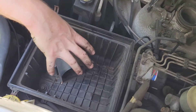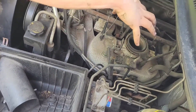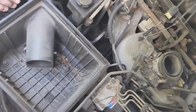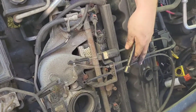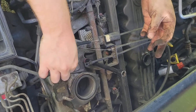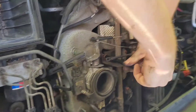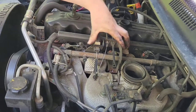I was able to remove the top of the air box using the two hose clamps, and then the top of the intake that bolts down onto the throttle body removes with this hose clamp right here. I'm swinging the throttle cables out — I was able to loosen them all up off of the arm — and now I'm loosening the bracket that holds the cables. Once I can get this out of the way, we should just be able to proceed.